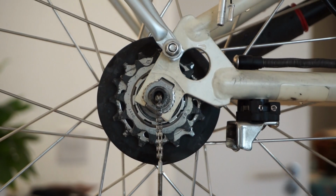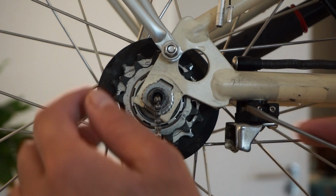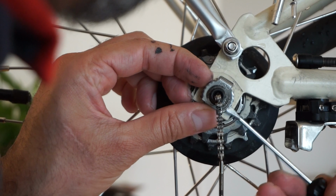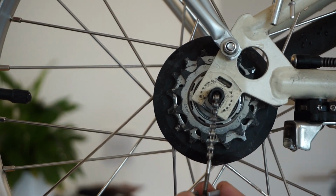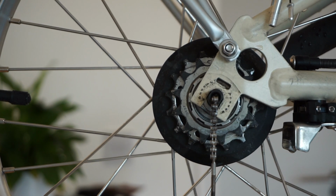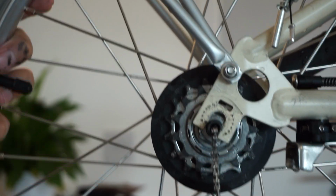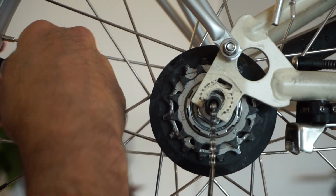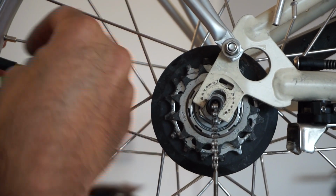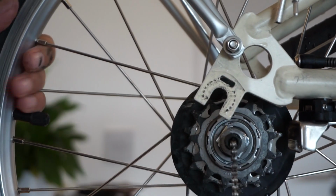Now Brompton have these stays in place. You just use a little screwdriver to pop that off. And there we go, that's off. Again, take it off, put it down to this side. Now it's a similar procedure on the other side, of course more straightforward, as we essentially now have the wheel loose, and we just need to unloosen it, making sure the brakes are holding it. The other thing you need to do is let down the tire pressure. Tire pressure down, comes off, a bit of a wiggle, and we get the tire out.